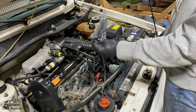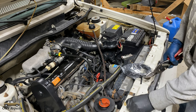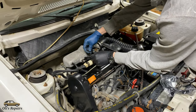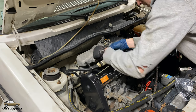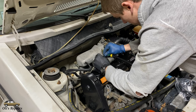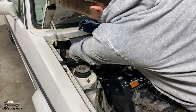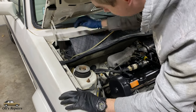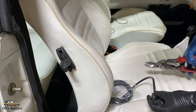I have this silicone vacuum hose ordered off Amazon to replace some of this other stuff. First let's cut two pieces, maybe about two and a half inches long. Carefully connect the first piece to the check valve, and then the second piece goes up here to replace this portion. Slide it on and connect the hose. Before we crawl into the dash, let's have both pieces of vacuum hose attached to our check valve.